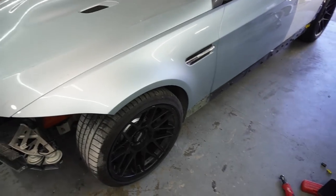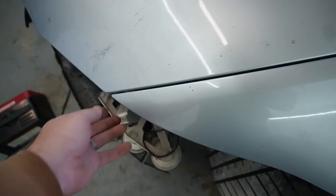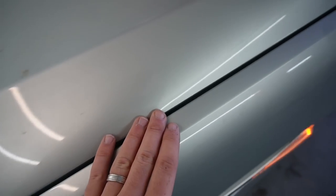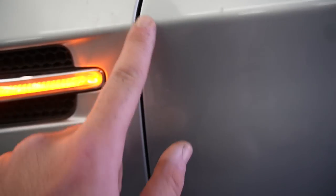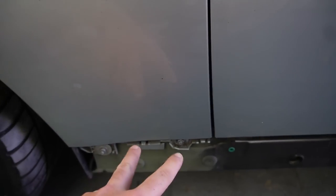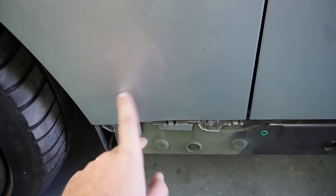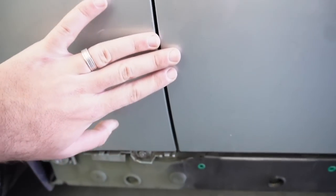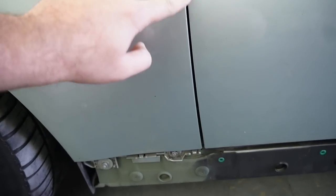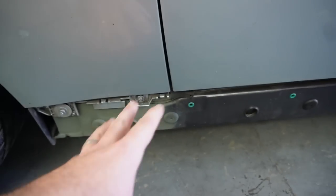With the power of editing — garage is cleaned up — check out this fender fitment. It looks absolutely amazing over here. I got this gap line perfect on this side too. The two brackets I welded on this side ended up being perfect and didn't fall off because I cut them a little bigger. I was actually able to use the factory screws to get it in there. The gap is a little tight up top but gets a little bigger down here, so I can adjust the bottom more down the road. Not a big deal.